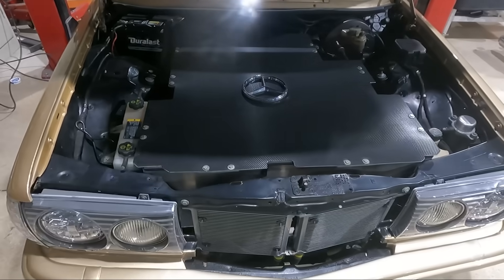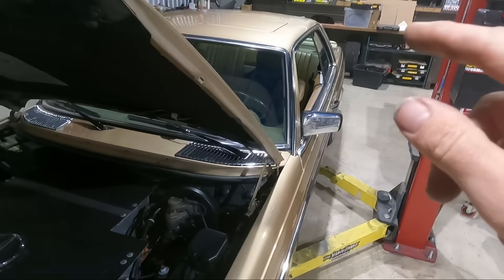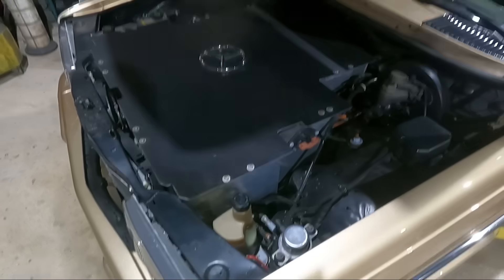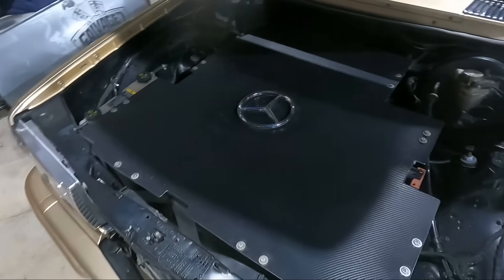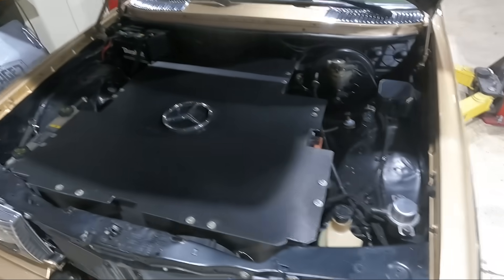Here is our existing battery pack — it's a 2012 Chevy Volt battery pack. There's a second pack where the gas tank was and in the transmission tunnel. So what we're going to have to do is take this cover off, undo all of our battery connections, and then once the batteries are disconnected and safe, we'll remove them one by one.